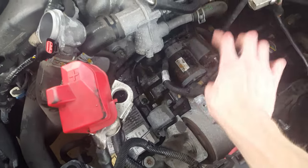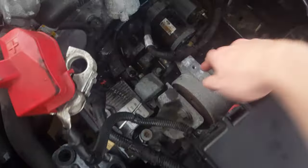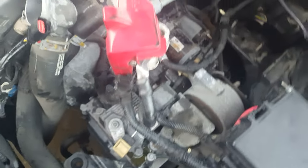You'll need to move your battery tray. You'll need a 10 millimeter deep well. You've got two nuts here and a bolt here. Take the battery tray out — it'll also be clipped in by these plugs, basically the terminal wires.